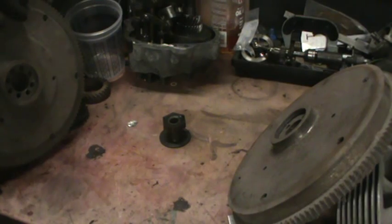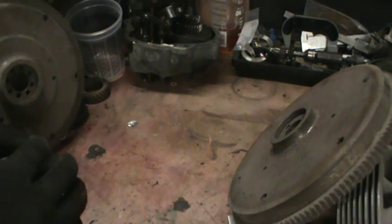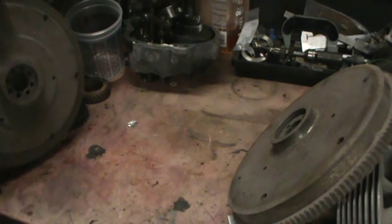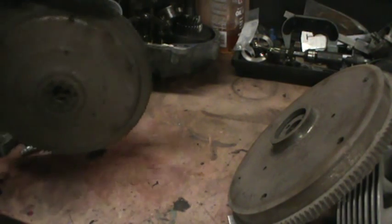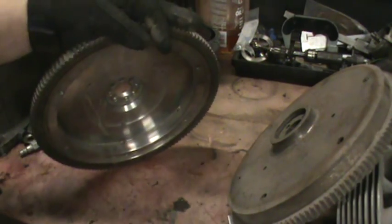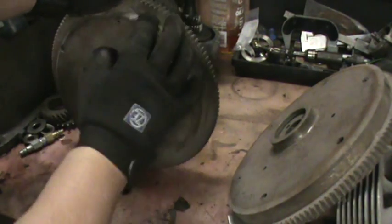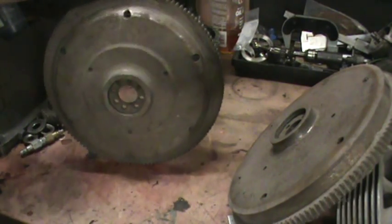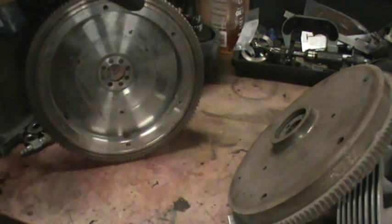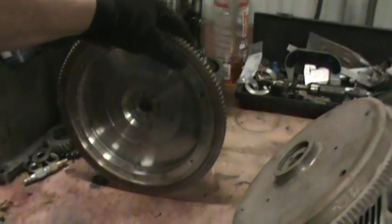The question was about a light flywheel — the pros and cons. One of the benefits of a light flywheel is the motor will accelerate quicker. You do lose some crankshaft inertia, meaning the time that the motor stays up. If you're doing a lot of driving on the road and you let off the gas, it will decelerate quicker. Light flywheels tend to be used in drag racing. Most guys will order their aftermarket crankshaft with an 8-dowel flywheel, and it'll be lightened.